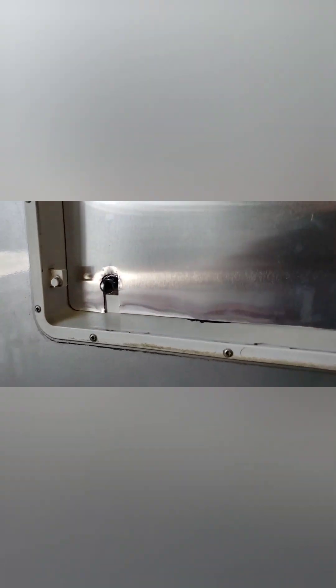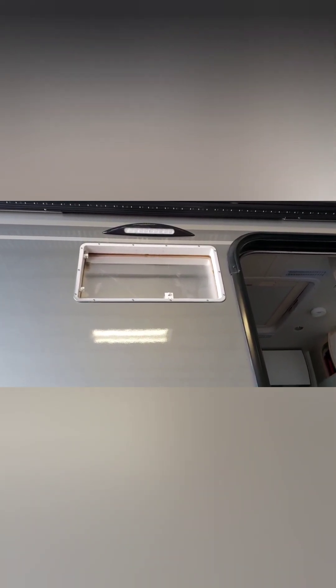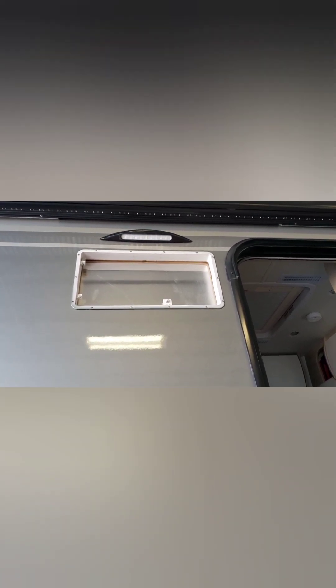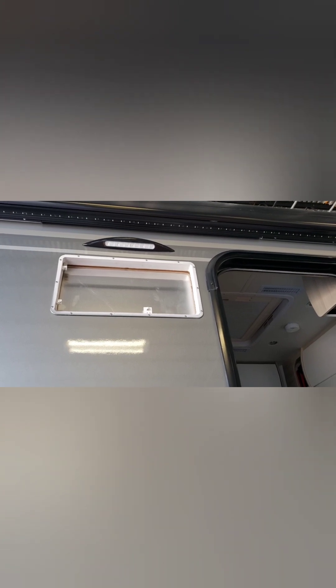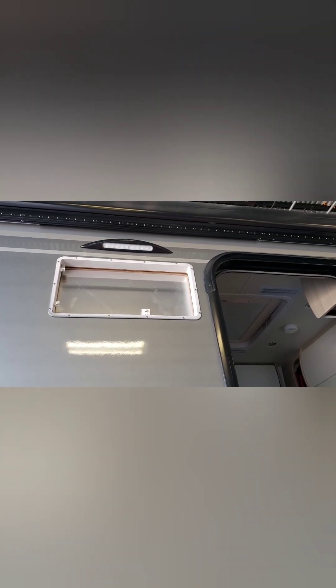So I made my cutout for the bottom vent. I have the drain tube sticking out. Now all I need to do is caulk this. We had already put a cover from the inside on the inside wall to seal off that vent. So now all I need to do is caulk around it and then we'll be able to put the grills back on.